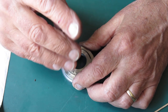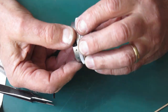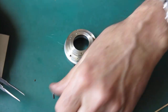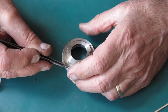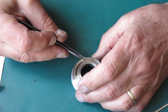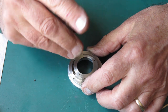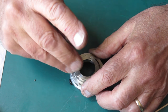Of course this was in quite good functional condition when I started, and it's nice and smooth now — the action of the depth of field pointers is nice and smooth, everything moves easily. So that's exactly as I need it. The lens capsule itself I've got to deal with next. There are three things to concern yourself with: one is the state of the glass — do you need to dismantle the capsule to clean the glass internally, or does it only need the outside surfaces cleaned? In this case the glass is quite good.